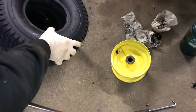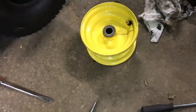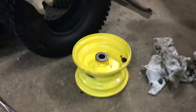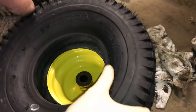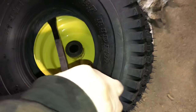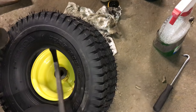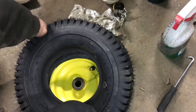New tire. There's normally not a direction they go — I haven't seen a tractor tire that's actually directional other than the big back tires. You can put a little bit of Windex or maybe some Simple Green to make it a little bit easier going on. Sometimes that works, sometimes it doesn't — if it gets too slippery then it's really hard to get the tires on. I'm going to try it without first. Just pushing down on top. You want to get the inside first — I call it baby steps — just take a little bit of a bite at a time. I'm not using the Simple Green because the tire is actually sticking better to the rim.